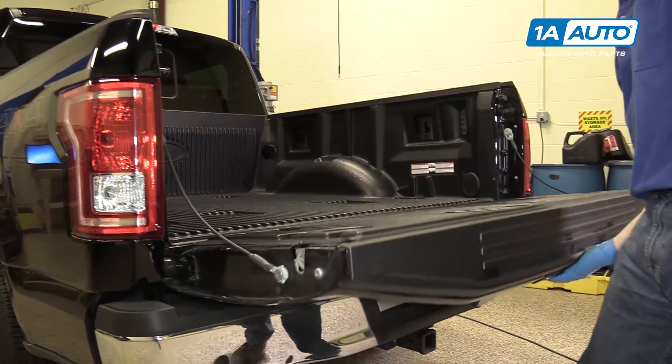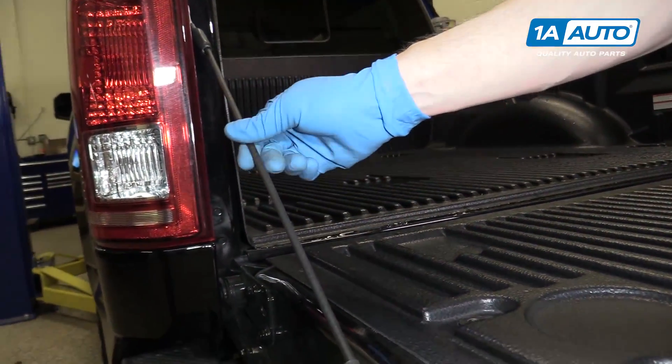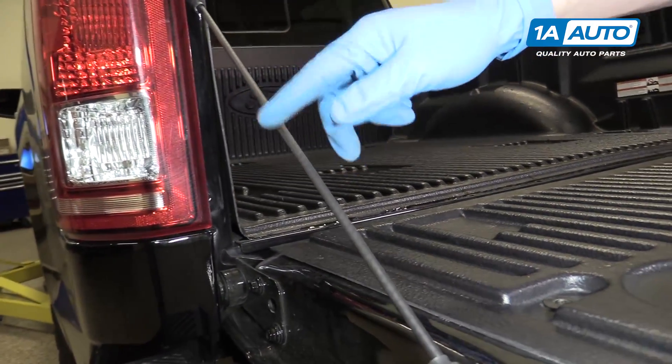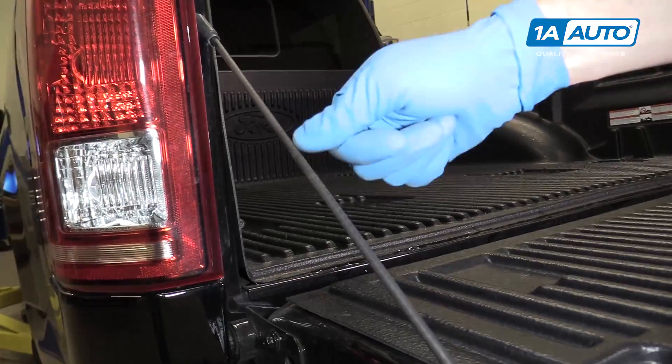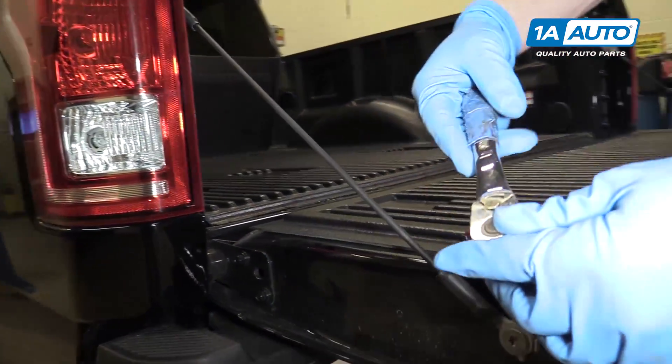Open up your tailgate. Check your tailgate every once in a while — a lot of times what happens is the rubber casing frays, and then the steel cable inside will fray as well. There'll be little tiny sharp things that can poke you when you're loading and unloading your tailgate. Replace them.